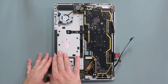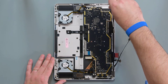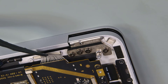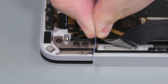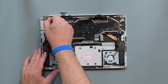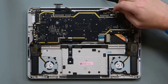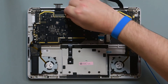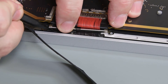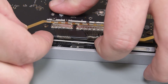Close the device, and then loosen all 8 hinge screws. Adjust the alignment until the back edge is flush across the hinge, and then verify that a 0.2mm feeler gauge can fit easily in the hinge gaps. Tighten the screws, and then once again check the alignment and gaps. Connect the display cables, and then position the cable tensioners into place, ensuring that the cables route over the plastic guides along the edge of the motherboard. Do not push the display cables in with anything other than the cable tensioners — this is critical to avoid damaging the cable wraps.